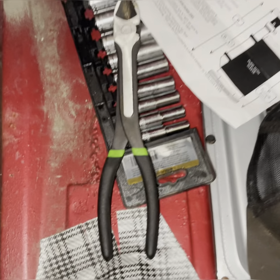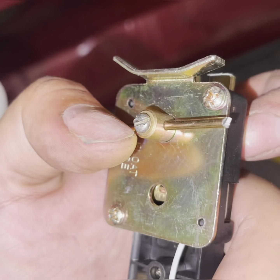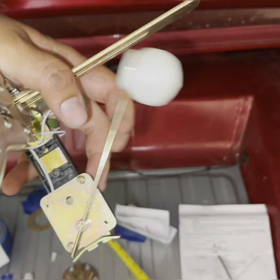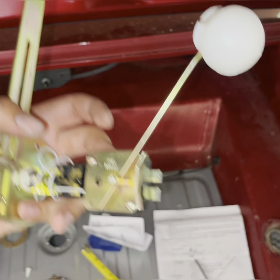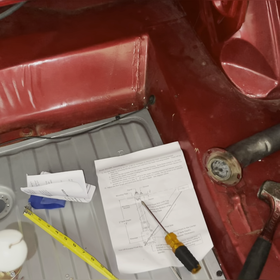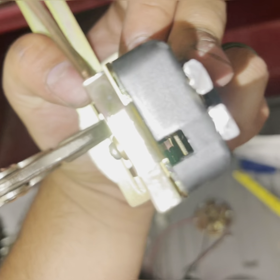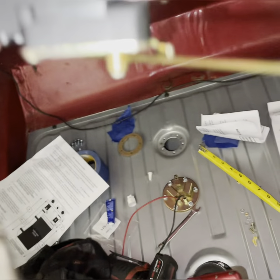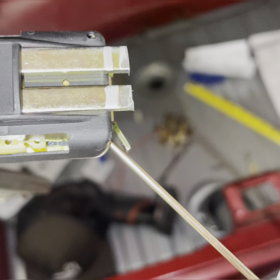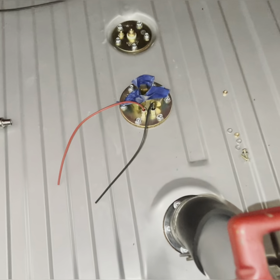Now you've got to cut off the excess — I'm using a pair of cutoff pliers from Harbor Freight. I'm not sponsored by them but they cut through this like butter. There we go — now you've got your fuel level sender with the float all the way down. The float is supposed to be wobbly — when fuel's in there it'll go up, when it's not it'll go down. You had to cut off that bracket excess like the instructions say because you can't have the bracket touching the bottom of the tank. Remove the clamp, drop it down, and you're good to go — everything here is done.